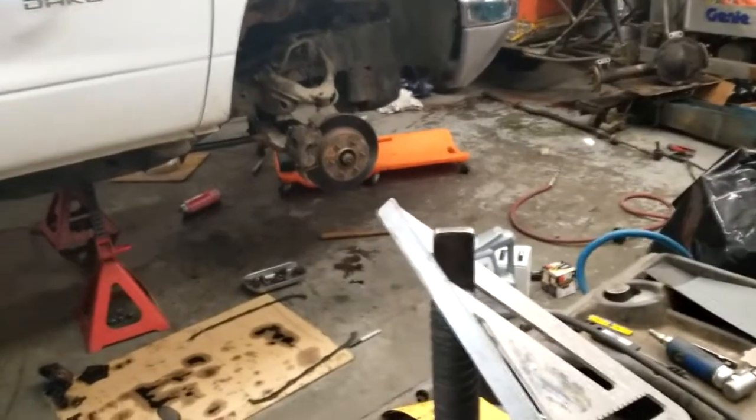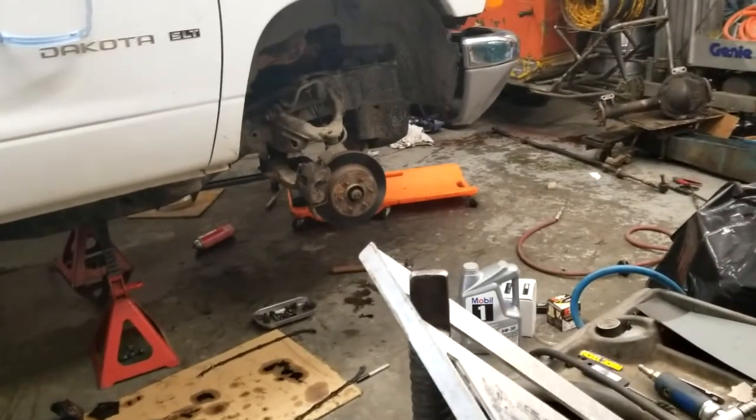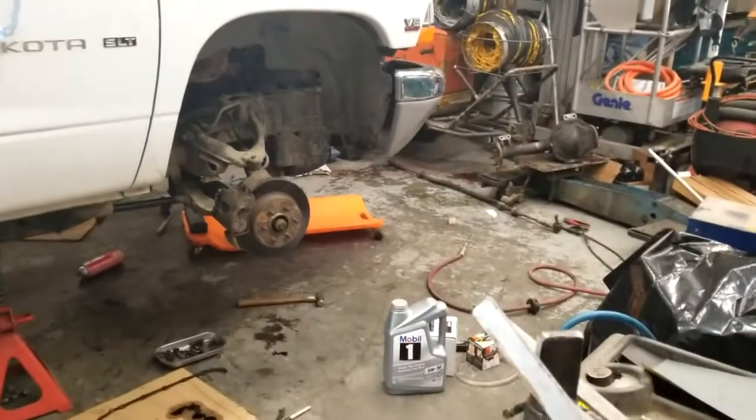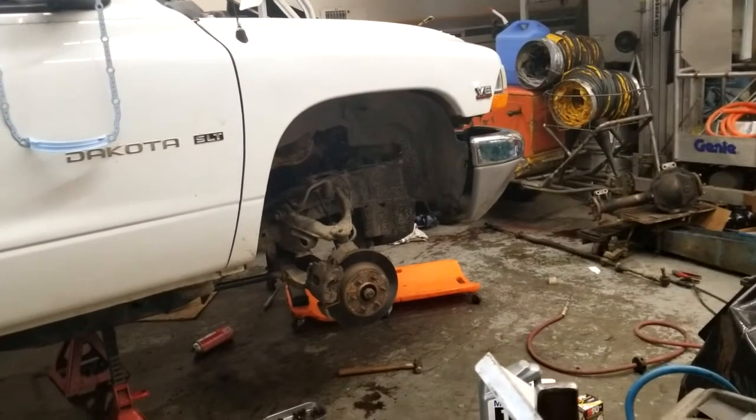We got the rear main in the right direction. Sweet. So now I got to put these bearings in this one and get the other bearing in the top there, which shouldn't be that easy considering these are frickin' fat. And, well, the other ones didn't really want to go in there that good either, especially that thrust bearing. I've already got all my oil pan surfaces and my bearings polished and cleaned, because I've been spending so much time waiting on parts and doing everything that I've really all just been doing cleaning. So hopefully this 2.5 week project might get fired up today, tomorrow, hopefully today.